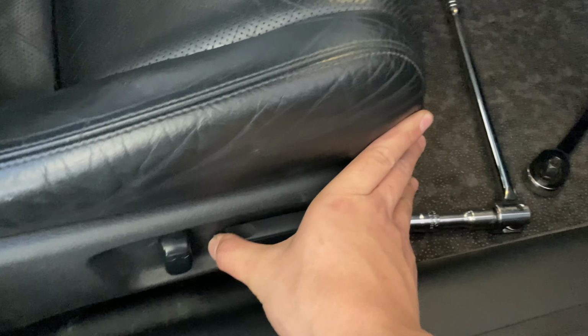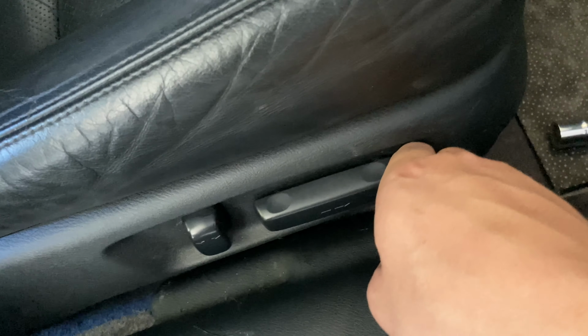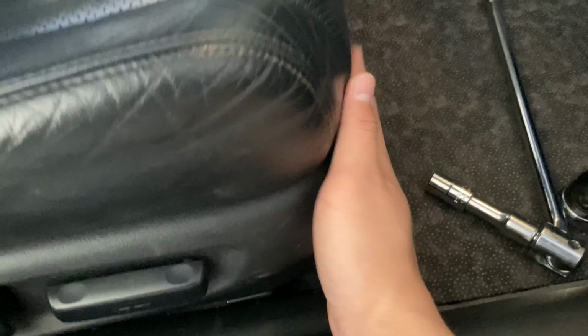for the front rear. So you go ahead and push the seat back, and then just loosen the bolts from there. And then you push the seat forward, right? And then you get access to the rears. So once you loosen those four bolts, push the whole entire chair aligned to the railing, like that. So this railing, the end where the socket goes, stays beneath the chair, so it won't stick out. And same as well for the rear.